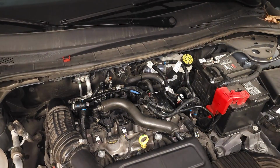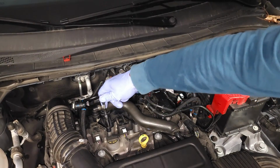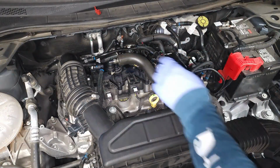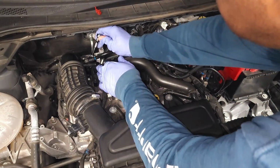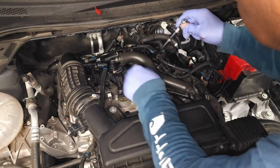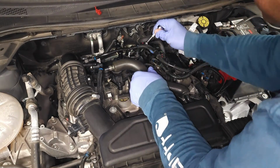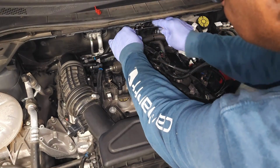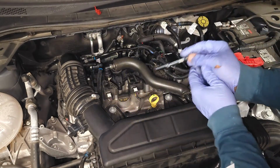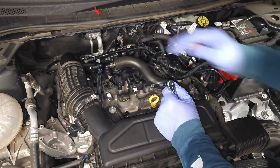So, as I said, tighten from the center. So I'm gonna put probably 10 pounds of pressure. That's all it needs. Right here. Then I'm gonna go straight to the back. Move to the far corner. I'm going to cross over here, this one right here. Okay, back to the back. There you go. And finally, back to the front. So you see that was 1, 2, then I went 3, 4, 5, 6.